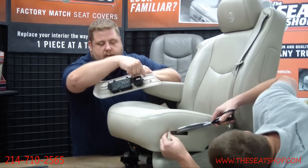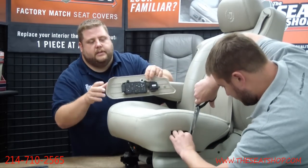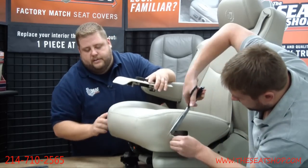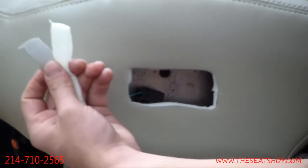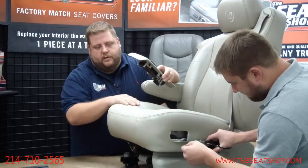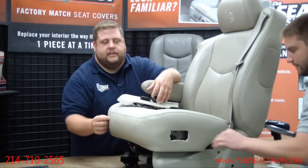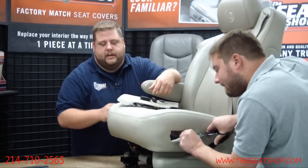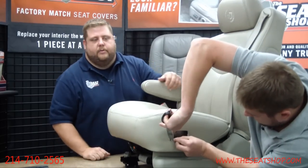There's a metal frame that goes around this outer perimeter. You can also see where there's a little post — we're going to line up where the screw holes are. You can tilt it up on the side and see exactly where it is to make more precise measurements when you're cutting. There are also two layers: you've got the side paint panel which is vinyl, and behind it you've got the quarter-inch foam. It's sometimes hard to cut through both, so once you make a small slit and get the hole started, you can grab the foam on the underside and cut a big chunk out, trim the foam out, and then come back and make more precision cuts in the vinyl. Clearing out some of the foam gives you a little more room to work because with the vinyl and the foam it kind of clogs up the hole.